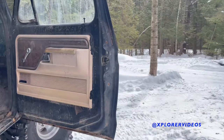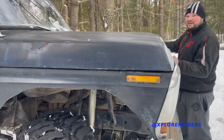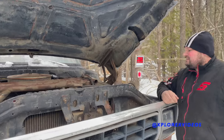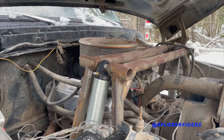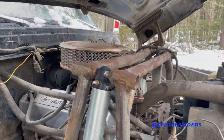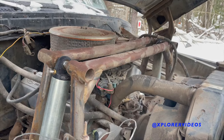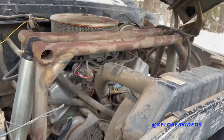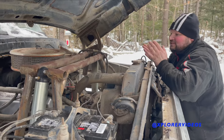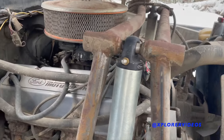Let's check out under the power barn. Unlike most Fords, it's hard to get the hood open on this one — you gotta give it a little slap. The 18-inch Radflo air shocks needed a place to live, so there's a large shock tower coming up off the frame. The Bronco came with a 351 Modified originally, and this one's a 351 Modified with a cam, intake, long tubes, and a Holley 670 Truck Avenger carb. Seems to run pretty good.